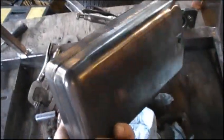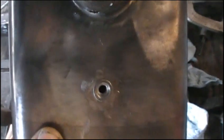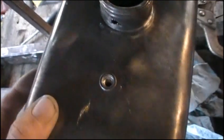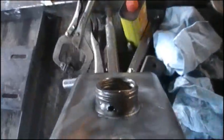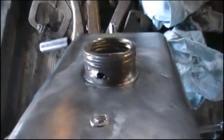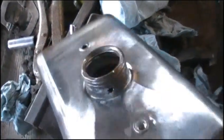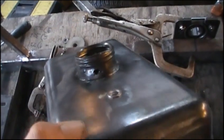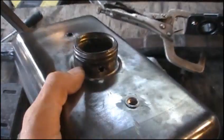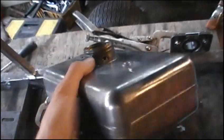The other thing I've been doing is working on the gas tank. I patched a hole that was in the bottom with weld and ground it flat, and I wire-brushed the whole tank. I replaced a nut-sert that was stripped and broken. I also tried to weld the upper part, but my welder just keeps melting through on the lowest setting, so I'm not really sure what to do there. I was thinking about getting it brazed by a professional. I don't want to use Quick Steel or JB Weld — I'd rather have solid steel — but brazing seems like the right call. Let me know what you guys think.